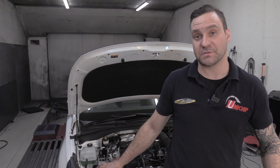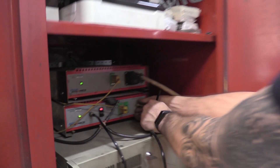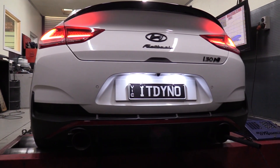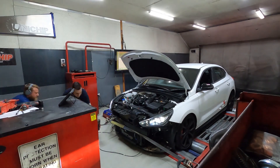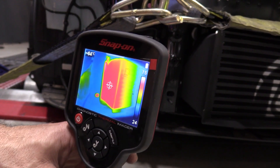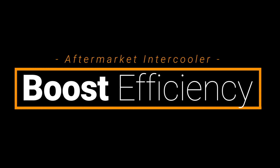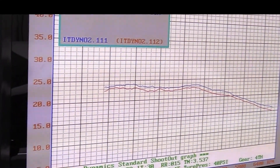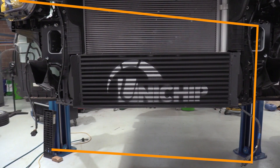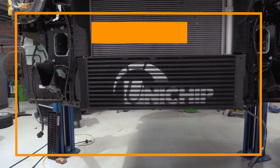We've come off the dyno having fitted the Forge Motorsport intercooler after running all the data on the standard one. Exactly the same setup — probed both sides for pressure difference and monitoring intake temperature. On the temperature side, the hot side externally saw 64 degrees with the cold side at 27 degrees — a big difference of 37 degrees. Keep in mind these are aluminium end tanks, which is a really great result. For boost efficiency at 2,500 RPM, the hot side was 23.4 PSI and the cold side 22.7 PSI, giving an incredible result of only 0.7 PSI pressure drop. Definitely some great results for the Forge Motorsport intercooler.